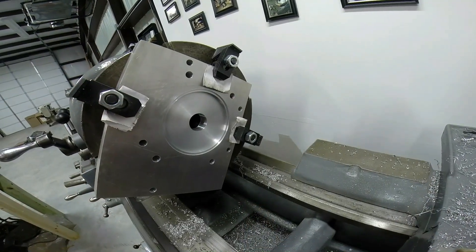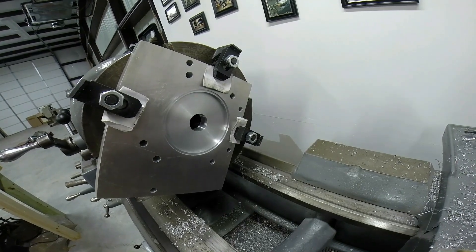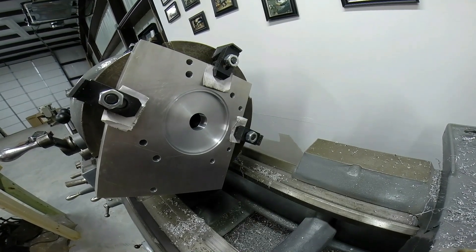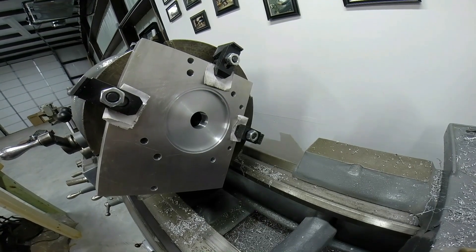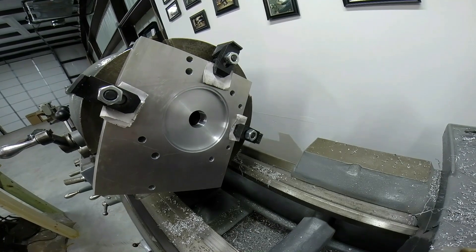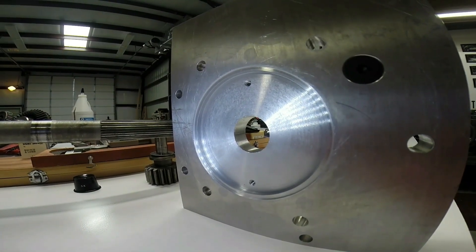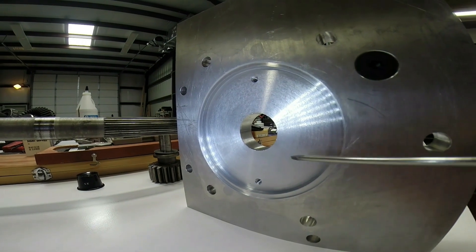Here you see the adapter plate that's been machined for the tail shaft bearing housing, so that once in place it can be bolted directly up against the Saginaw transmission to hold the tail shaft bearing housing in place. You can also see that it's got a relief groove for clearance for the snap ring. This adapter plate also accepts the C5 bolt pattern for the Corvette differential, and the main shaft bearing housing is held concentrically by the bore of the adapter plate.